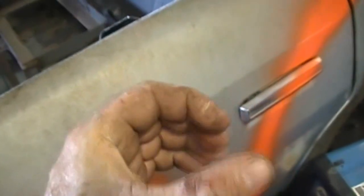I'll go over a trick here for you. Let me open the door back up. I like to beat this door down. You'll see a lot of people do that. I do it because think of it as an open tin can like that. It crushes a lot easier, but if it's capped off, it's less likely for this to crush in. I know that probably doesn't make that much sense to do to your doors, but it really just makes your doors less prone to get punctured.